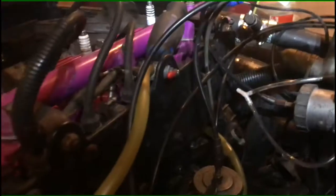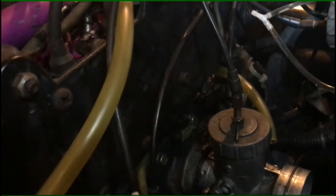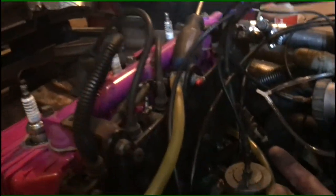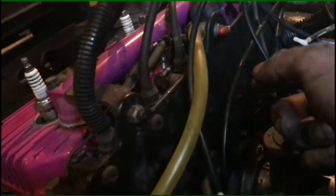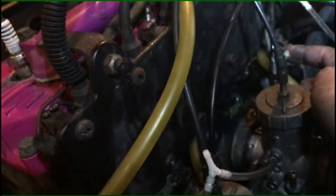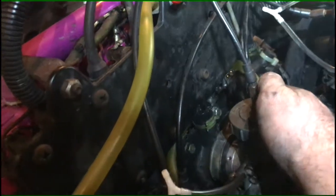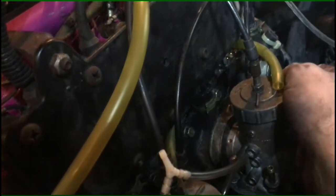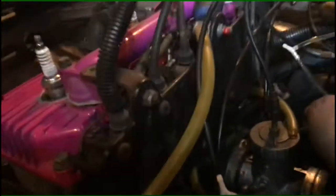It goes under your base. Whatever terminology you want to use, it's your vacuum line or your impulse line. It's the line that creates the surge, your vacuum charge for your fuel pump. I have another piece of hose and can replace the line if I have to, but I might just be able to snip it off and stick it back up there and be okay. Okay, we're all buttoned up here.